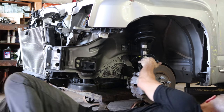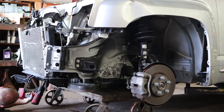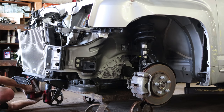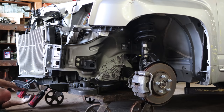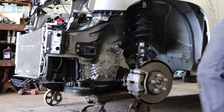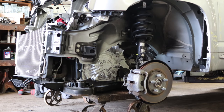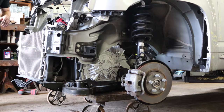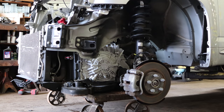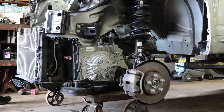Now I've disconnected everything — all the hoses, wires, cables — so we can drop the subframe down. You want to drop it onto a cart that moves in 360 degrees. If you drop it onto a cart that only moves forward and backward, it's nice for moving the motor around, but when you try to put it back in, you're never totally centered by eyeballing it and it makes it really hard if you can't slide the cart side to side. Once you start lifting it, lift a couple inches at a time and check to make sure no wires are caught. Things have a way of finding their way into other stuff and getting caught. If you just start lifting it up, you'll end up tearing wires and hoses. Lift it little by little and keep checking until you're sure nothing can come in contact with anything else.